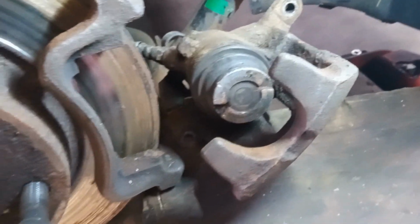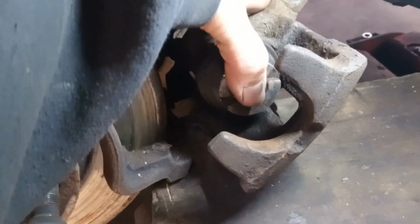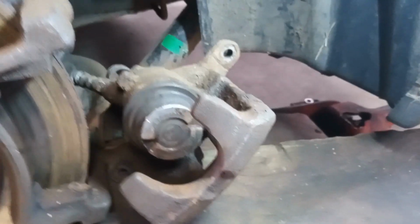And that's what a lot of people struggle with. So I'm going to get a clamp on here, some gentle pressure in between. I'm going to rotate it clockwise until it goes in, after I've WD'd in the inside. It's just proper procedure. Right, so for this job, we're doing the Vivaro calipers, rear, and the handbrake, right?